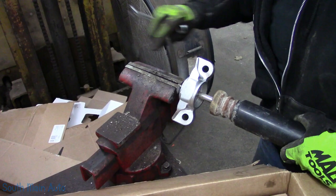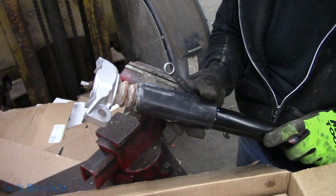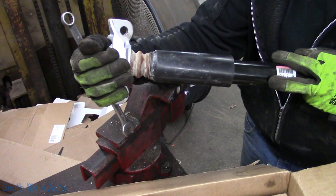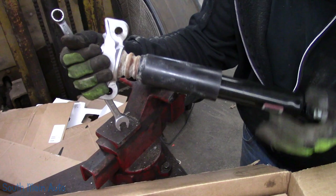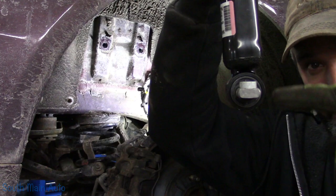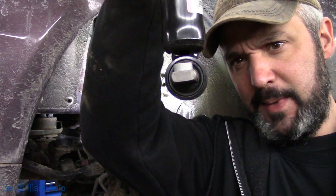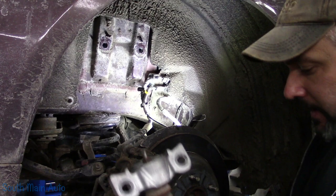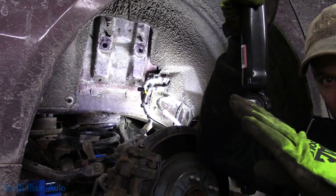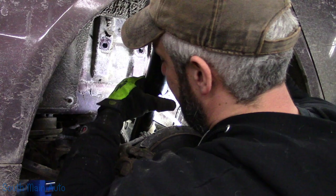Our damper just sits up in there. I pulled the one out on the other side — there's another portion of this that is down inside; when you set the car down that's what keeps it up. Now when you go to slip these little guys back in, be mindful of the position of the bottom of your shock. That rubber bushing is solid so it's not rotating — you can see they're slightly canted. Rotate it so the taper is facing towards the inside of the car and it'll match up with your lower control arm.